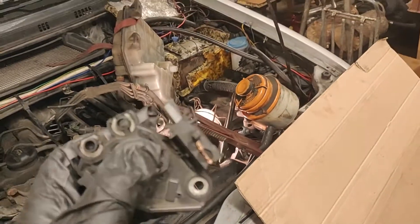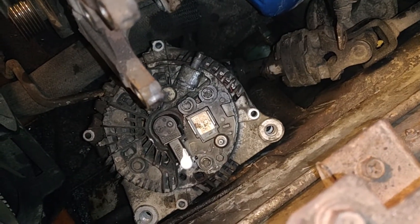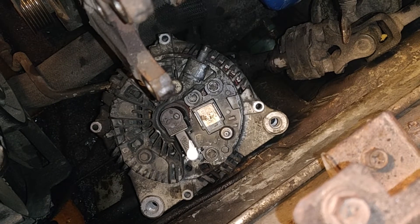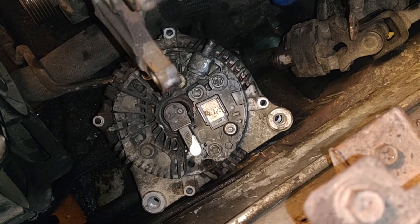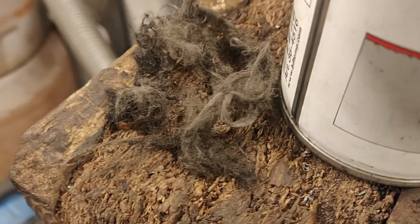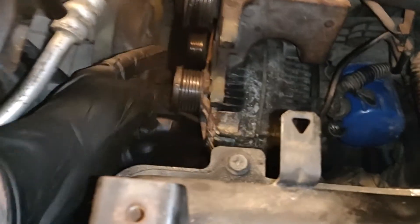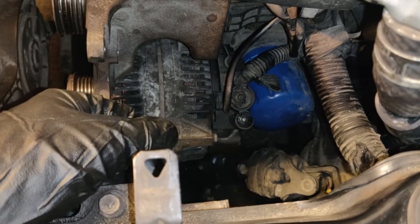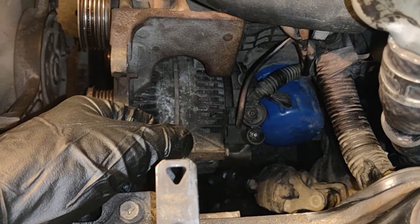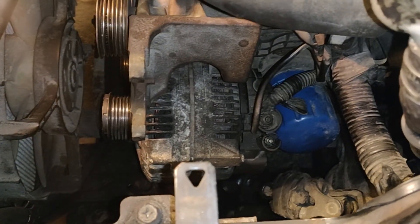This is going back into the car on the alternator together with everything else. I've put the regulator back — regulator and brushes. I added some silicone to protect the solder joints. I found some hairs inside the generator — pretty sure they're not supposed to be in there. The generator is in place with four bolts, two on each side, but the bottom one is so hard to reach that I couldn't get it in all the way. The other three are tight, so I'll be satisfied with that.